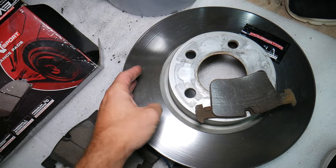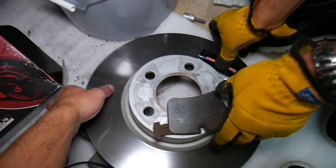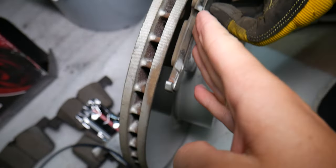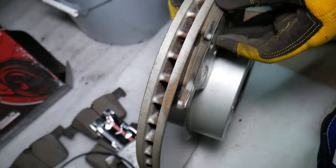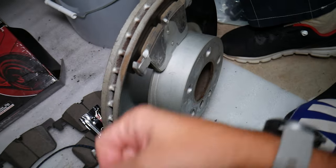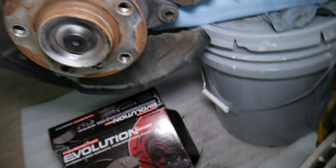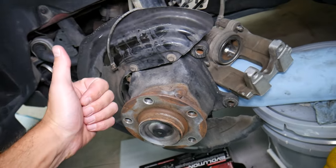In some cases it could be a disc rotor that isn't straight — it has low and high spots, which is called brake pulsation. We have a special video about what causes brake pulsation, and it could be your own simple mistake. When you have brake pulsation, the pads go up and down following the low and high spots, contacting only a few spots on the disc. You'll experience vibrations, pulsation, and your brakes will get really hot fast when going downhill or through mountain passes. Those are some of the most common reasons — hopefully this video was helpful. Thank you for watching, see you next time.